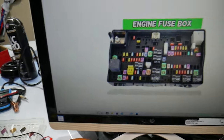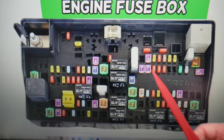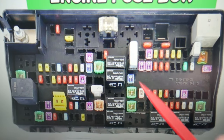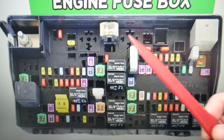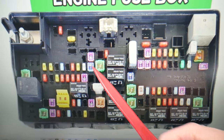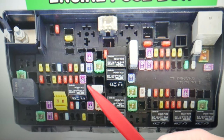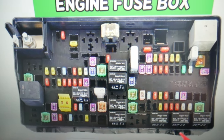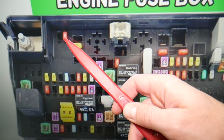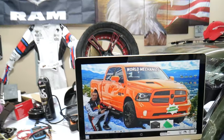For the active grill shutter, we need to check just one fuse. You can see there are all kinds of different fuses and relays in here. We always recommend keeping some spare ones — if you're in a small town in the middle of nowhere and can't find a replacement, you may be stuck. So always keep some spares in your fuse box. The fuse for the active grill shutter is fuse number 41 — a 10-amp fuse, right here on top. Hopefully this video is helpful. Thank you for watching — see you next time.